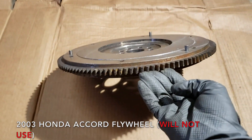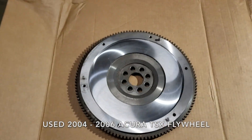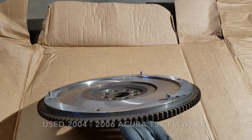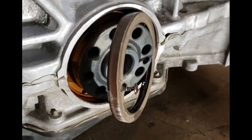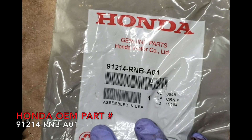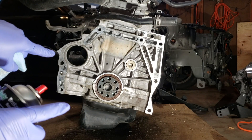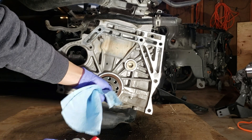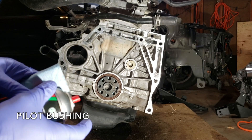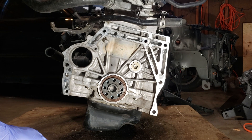To the left will be the TSX flywheel, which is a step-down flywheel, which I had to get for my OEM clutch to work correctly. I made sure that I had it resurfaced. I recommend replacing the crank oil seal with an OEM part — they're only around $11. I will put the part number in the description box below. I'm going to clean the inside of the crank where the pilot bearing goes. It looks already clean, but I just want to double check.